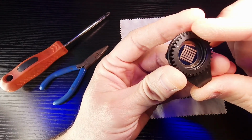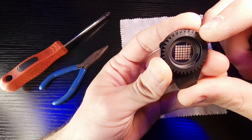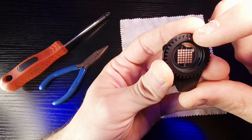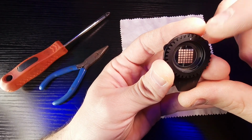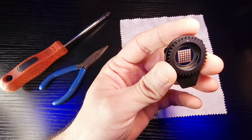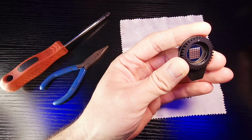One thing to remember is, however the orientation of the gobo is, how you want it, you got to make sure you match it up with that little silver circle here. So the factory wanted it this way, so they put it up facing the little metal cutout that they put in there. So make sure, however you want your gobo oriented, that it's facing the metal dot here.